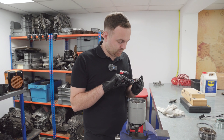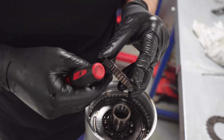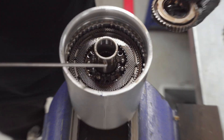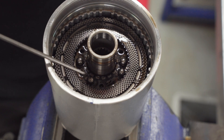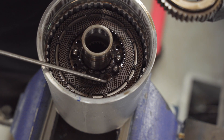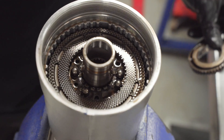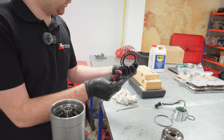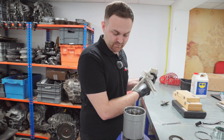I've just removed this little hub - this is where the steels and frictions ride off of, with a little roller bearing on top. And these are the ball bearings we're talking about. As I've lifted this one carefully, you can see the rest are all seated but this one's off to the side. What I think has happened is this one has come out of its groove - there's a little groove here it should sit in - and it's basically got jammed under the bottom plate, which has then jammed the top clutches and plates. If you put this on a flat surface you might find it's slightly warped where that bearing popped out, but yeah that confirms it.